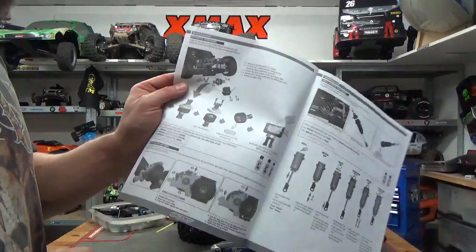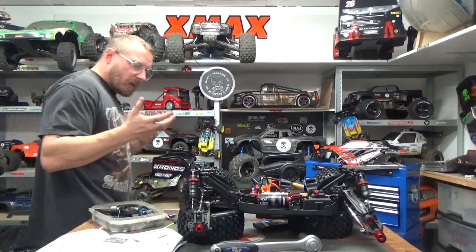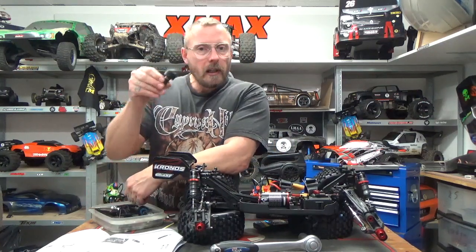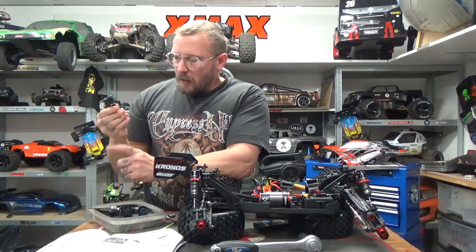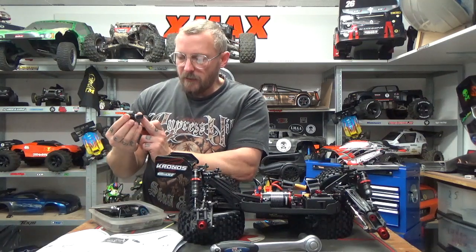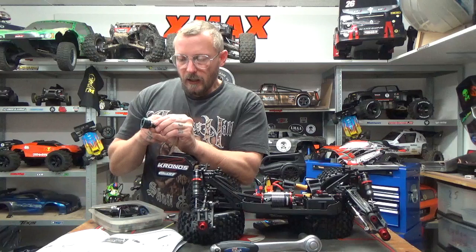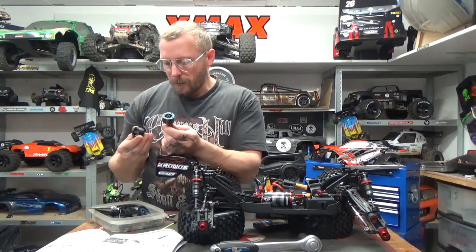It's way too light. And what a surprise, because I was really thinking that all 3 differentials work the same and really loose. So I open it and there's no oil in. There's just only grease, no oil. There's also no grease on the output drive in the diff, so you have to take apart all the differentials, put grease here on the nuts, put it again in the differential and put oil in the differential.